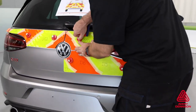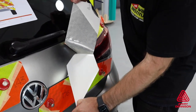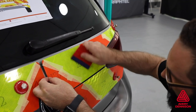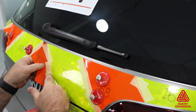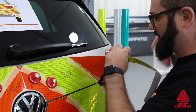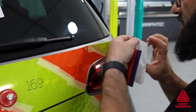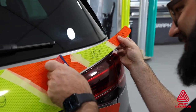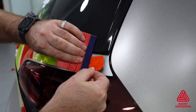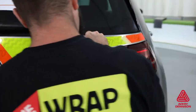Once the alignment is precise, it's time for the main install. Double up the magnets past the middle piece to ensure hold, then remove the liner. Hold the panel off the surface, then squeegee it in place using an Avery Dennison squeegee. Installing the middle panel first will help ensure that the other panels on the left and right align precisely. Work one panel on a section at a time. The masking tape that holds the panels should keep them uniform and symmetrical. Be patient and steady — this will help ensure alignment and precise placement. Once the final piece has been applied, remove the masking tape. Be sure to remove it low and flat. The panels are butt-jointed; there should never be overlaps with V8000, as this helps ensure long-term quality and hold.